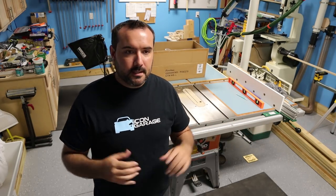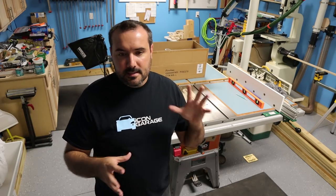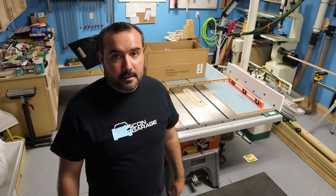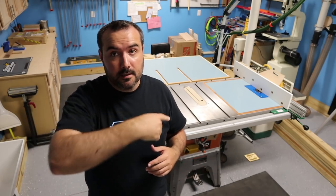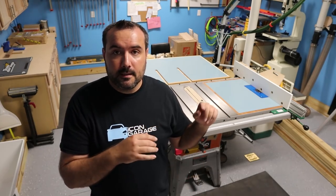I've been waiting on a lot of parts to come in and I think most of them have arrived. My first step is going to be to get all the rust and crud cleaned off the brakes. I do have rebuild kits to redo all the seals and perishable items in the calipers, and I got as many replacement bolts and nuts as I could find. We can do all of this out here in the workshop.